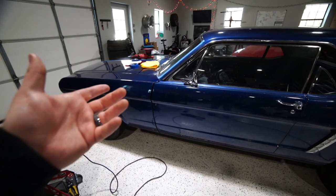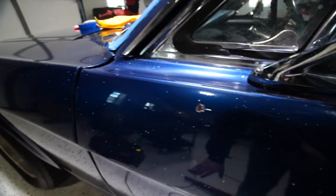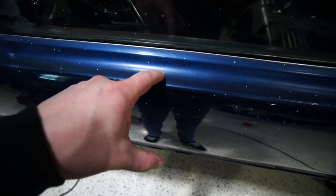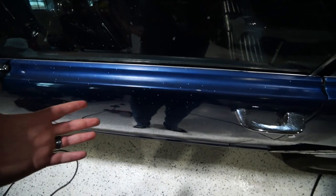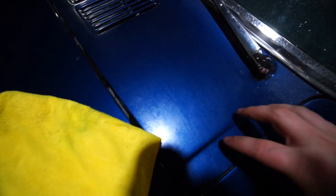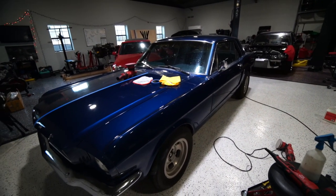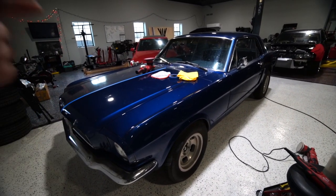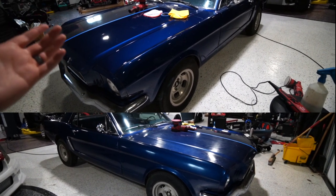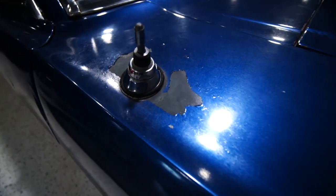If I had to guess, this is probably a Maaco paint job. The reason I can tell is the prep was crap — Maaco does not do a good job of prepping. You have so much chipping everywhere. The paint is soft and smooth but you have these giant chunks. The paint is so brittle that if I do any more sanding, it's not going to just take the overspray off, it's going to take the entire top coat off. The goal today is just to make whatever paint we have look good — it's already shiny and looks way better. I'm going to have this car fully repainted eventually.